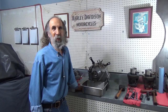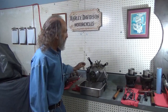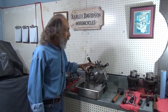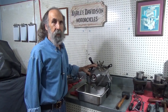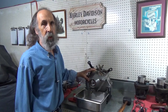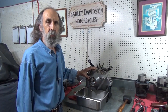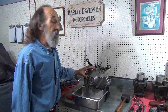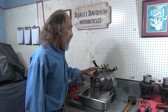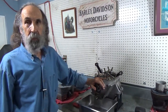Hello and welcome to Mike's Garage. On our last video, what we did is remove the top end from the 79 shovelhead motor. Now we're going to continue the teardown. Things appear to be in pretty good shape so far. We're going to have to check out and measure the cylinders, but it looks like a fairly fresh rebuild on the top end. So what we need to do now is remove the lifter blocks and open up the cam chest.